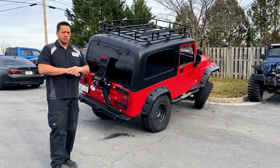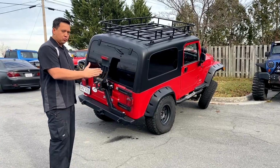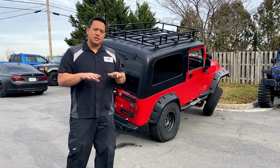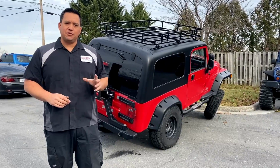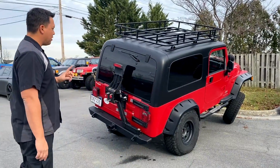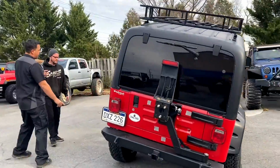Look back through the pictures. Look back through the flex competitions. When they flex out, these axles will steer, which means that every time there's an imperfection in the road, every time the body of the Jeep rolls just a little bit, your Jeep is going to steer without any input from the steering wheel, versus this one that's going to go straight, even if it goes to full flex at speed. So this is one of the things that I really like, but take a look also.